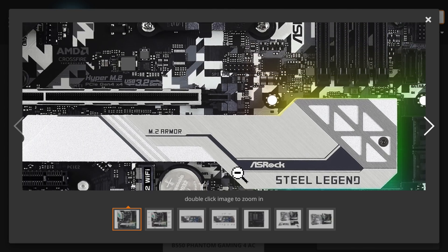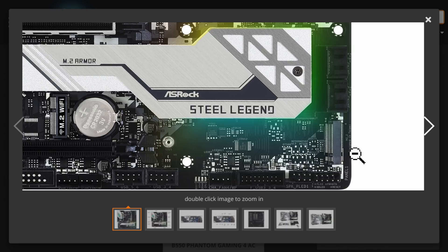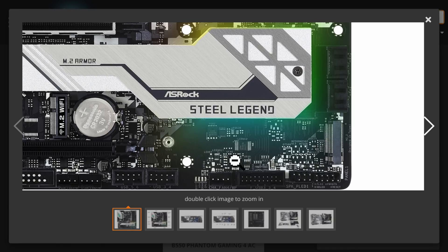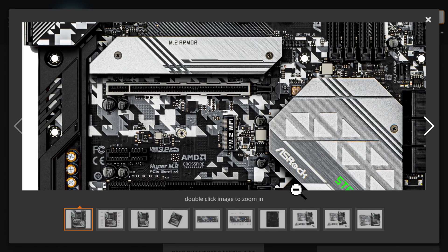Here's another fact: this is the primary M.2 slot for Gen 4. The second slot is two lanes, not four. And then the post issue — there were two small holes right next to each other in the case. We had the post in the wrong one so we had to take the whole motherboard off and re-post it, but then had to take the M.2 off to do that. Also notice on the full-size ATX version there's a heatsink covering the second M.2 slot, but on the micro-ATX version it's exposed — no cooling.